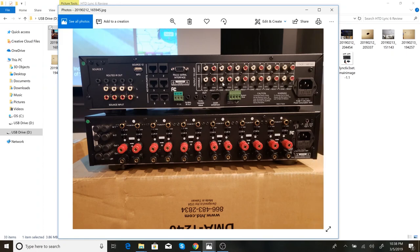Here's a shot of the back of the controller and amplifier. As I mentioned, each keypad has its own source input, but you can also plug into additional sources — inputs 7 through 11 are available. There's also a USB port for an MP3 player. What I did was take an old USB stick, loaded it up with music, and plugged it in. You can just select source 12 from any of the keypads or zones, and if you have relaxing background music set to loop, it'll just play continuously — which is nice if you want quiet background music without having a phone paired or a TV connected.